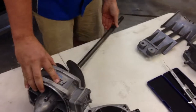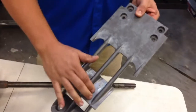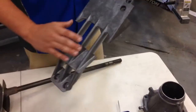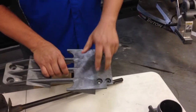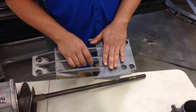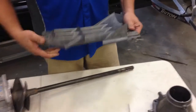Thank you, Yamaha, for doing that for us. The next item I want to show you guys is the new intake grate. Yamaha went to a top-loader design this year — previous years just had the straight bars. Top-loader is going to increase hook-up, acceleration, hole shot, and just overall handling and performance. Most impressive about this grate is we now have four bolt holes in the back for strength. Previous models only had two, and we've got some skis in the aftermarket pushing upwards of 9,800 RPM, so having this extra strength is very beneficial for those guys.